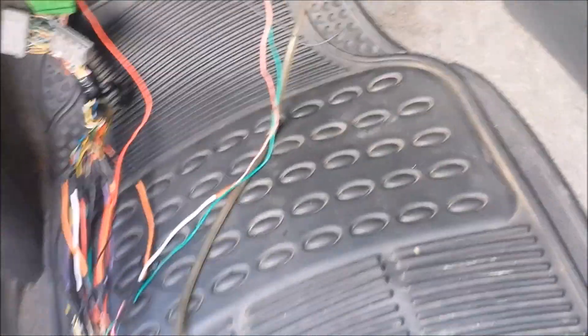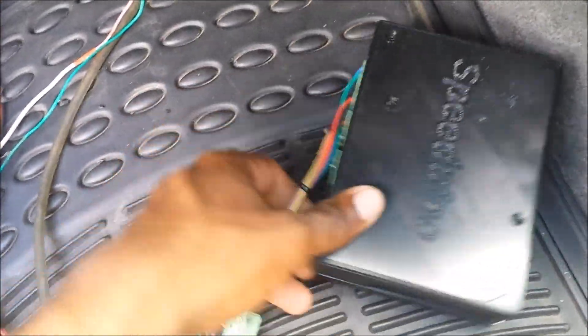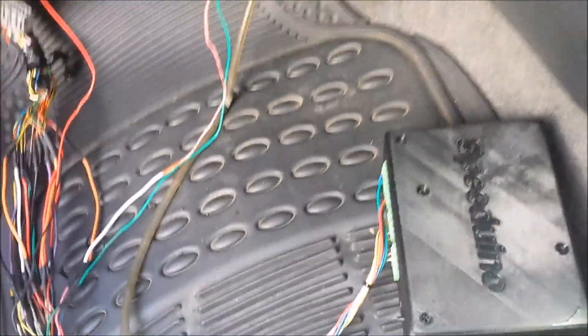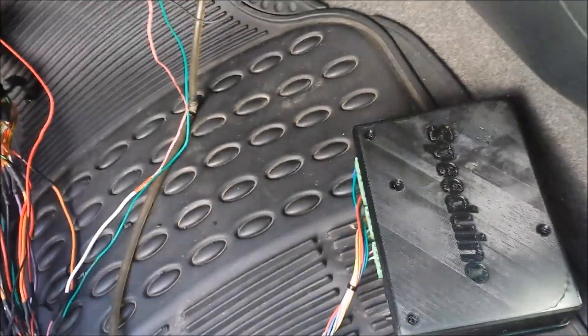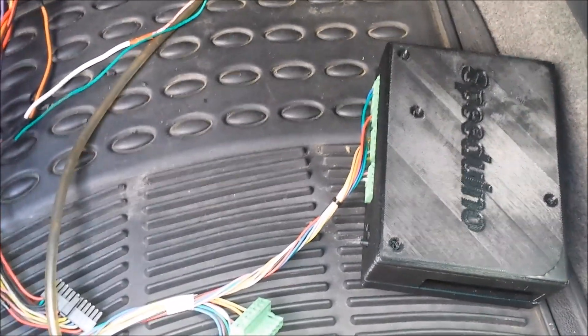It's pretty much good to work on any OBD0 to OBD2 Honda, and anything in between. So we're going to be installing this today — it's a Speeduino v0.3. They're both pretty much the same internally, only difference is this one is four channel and the other is two channel — not important. Figured it'd be a good time to make a video on how I wire up a Speeduino to a Honda. As you can see, my car was already wired for the Speeduino.